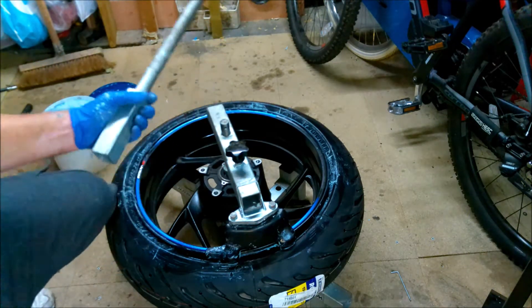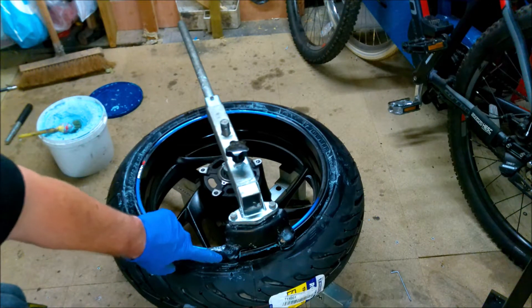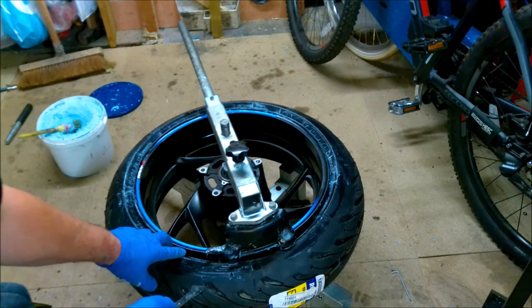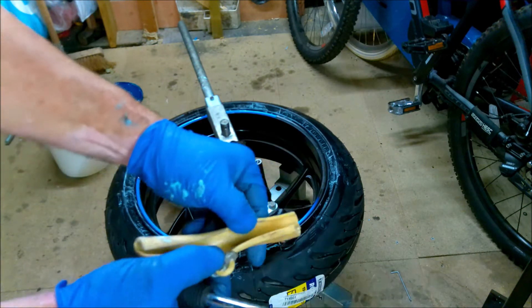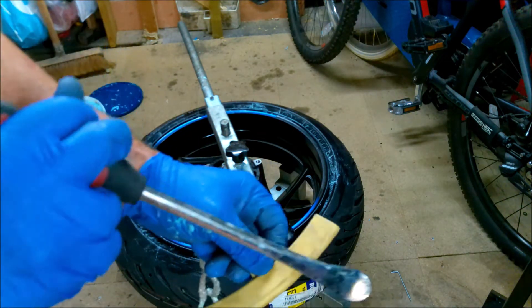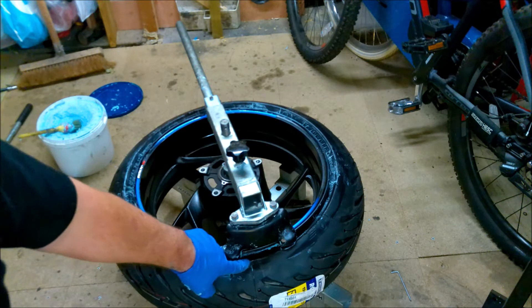Put your lever in - one of your tire irons - shove it in the tire on the edge of this plastic. There's a nice little divot there to enable you to get the tool in and not slip onto the wheel. If you want to lever it up somewhere on the wheel, these do come with covers which clip onto your rim so you can use a tire iron against that instead of ruining your rim. I don't generally use these and don't find I need them.